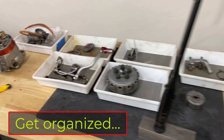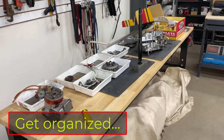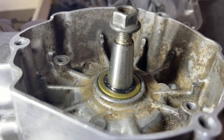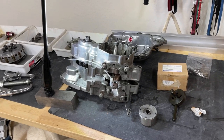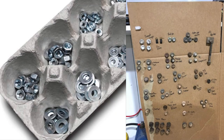It really falls on the technician and the do-it-yourself mechanic to understand when to replace a fastener, because the manual isn't telling you to. Taking all your bolts out, looking at them closely — sometimes you need a magnifying glass — and laying them all out to see if any are longer than others when they're all supposed to be the same height: that's a really good way to assess it. In the power sports industry, the 6-millimeter, 1.0 thread pitch fasteners are extremely over-tightened — I see a lot of valve covers, case covers, and block-off plates where people grossly over-torque them.